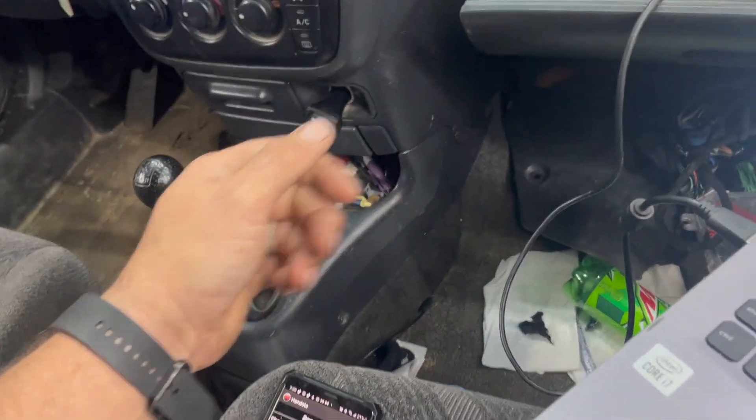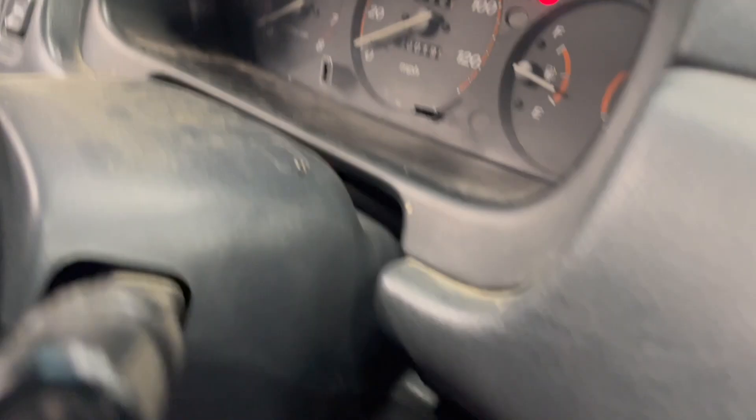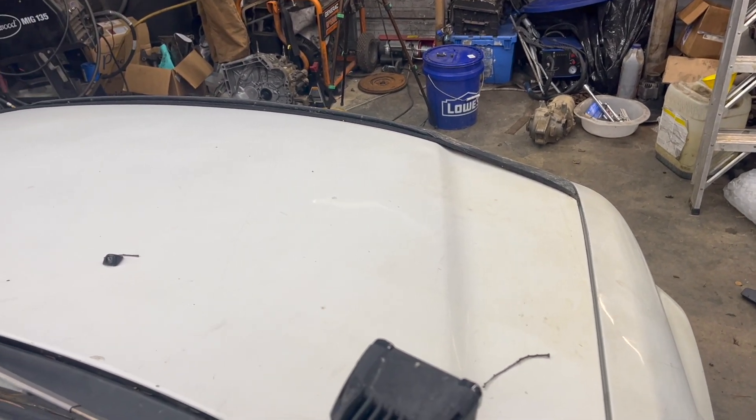Heck yeah, that's awesome! Now we can have AC when we first crank it up and not have to worry about it. Before those fans weren't cutting on — now they are. Sweet. It wouldn't have taken me too long to do this, had I not had some issues where my K-Pro didn't want to update from the computer. I had to restart my computer, log onto WiFi, and all that, but finally after I did that it loaded right up, no problem. So hopefully this helps somebody — probably not many people with a K-swap CR-V, but maybe if you have a Civic or S2000 or something like that with AC, this will help you get on the road with some good AC. Thanks for tuning in; I hope to see you in another video soon. Make sure you like, comment, subscribe. Peace!